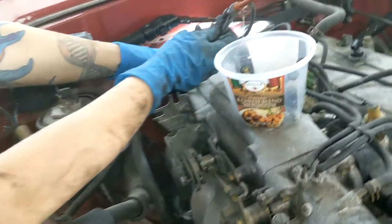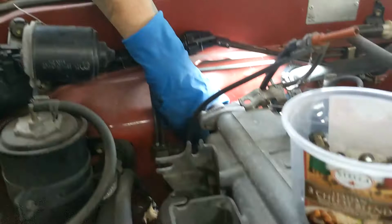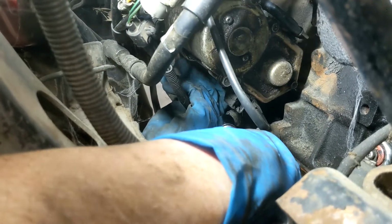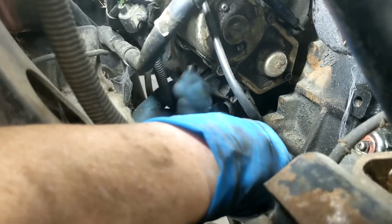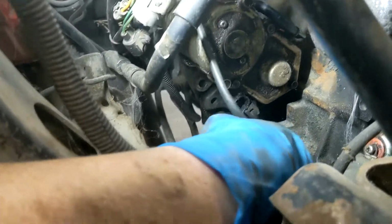If Danny Bonaducci had had a battery, this would be the point where I would disconnect it because now I'm going to take out the starter. The starter was held on with a nut on the top and a bolt on the bottom. I was able to get to the nut from the top, but I had to get to the lower bolt through the wheel well. This would be a good opportunity to disconnect the fuel filter from the high pressure fuel line, along with the transmission harness plug. I also had to disconnect the solenoid lead and the battery lead from the starter.